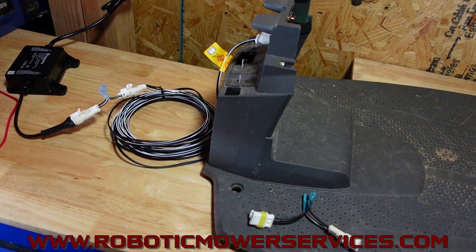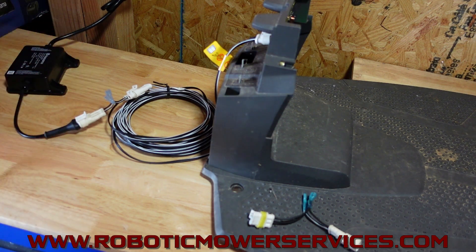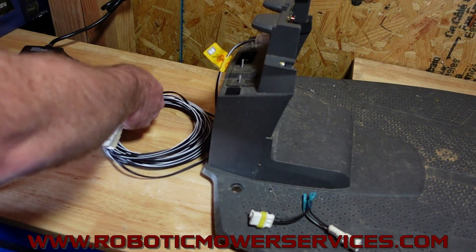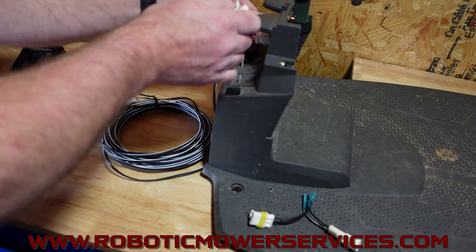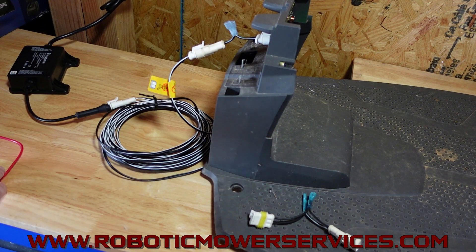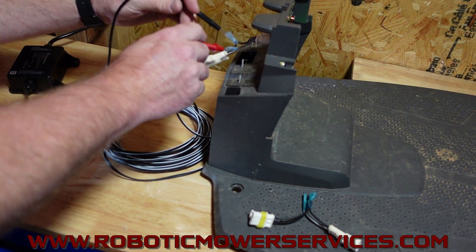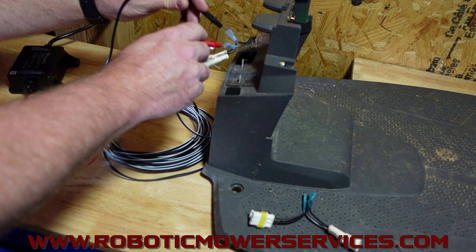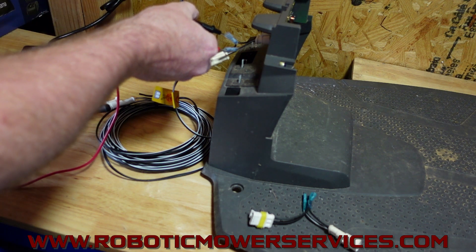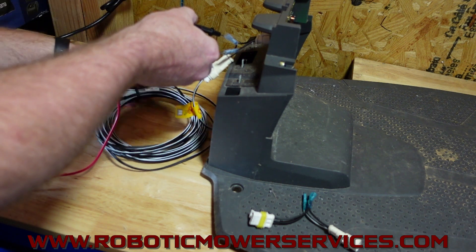You've got everything in line while it's powered on, so you can test your voltage right there at the female spade terminals and say, okay, everything's good there, but somehow I'm losing voltage because the LED is going out. Then you can move this one up the line to see what's happening further along. You can plug it in here — since the wires are the same configuration at both ends for this style — and check right up there: I've got 28 volts going into the charging station, so it must be the circuit board, or wait, I'm losing my 28 volts somewhere along the low voltage cable.